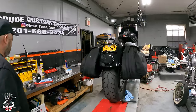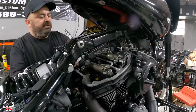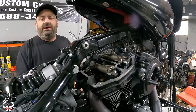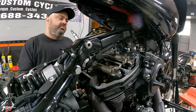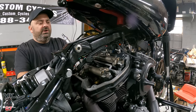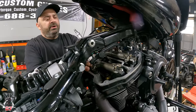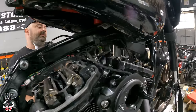What? How's that even possible? Well, Harley, you know, sometimes maybe the heads weren't machined. That's why some of these we think are louder than others. Maybe the heads aren't machined exactly the same. Maybe your prior problem where they lifted wore out the insides of the perches where the rocker shafts are, but this is excessive play. How about the front one?